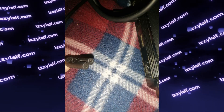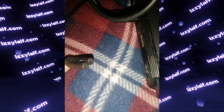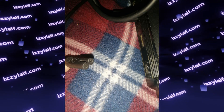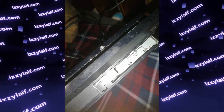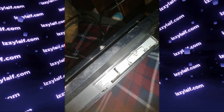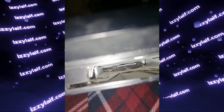To do that, first you need to disconnect everything from wall power — that includes the TV or any other monitor you're using, and the console itself. After that, you will need to remove the PlayStation 3 internal storage. It is very easy to do. First, locate where the storage is — it is held together by a single screw. Remove the screw, and then just pull the caddy out.